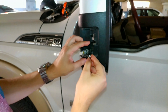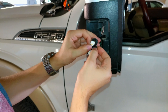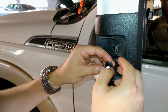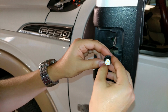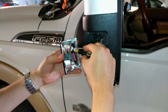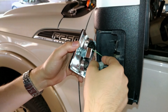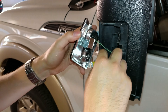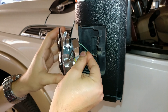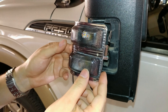Put this guy back in just for now until we get the new o-rings. You don't want to run them without the o-rings because your housing would not be waterproof. Put the bulb back in and twist clockwise. If you try to put the bulb in the socket and it doesn't stay, you're probably missing the o-ring — you'll need to get a new one.